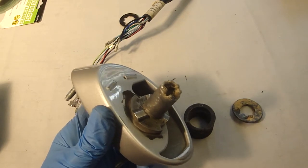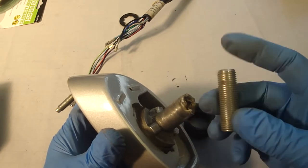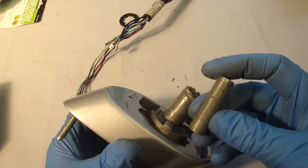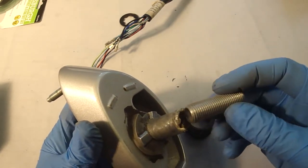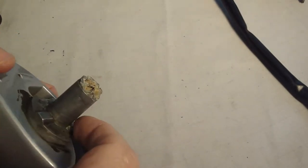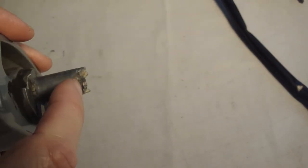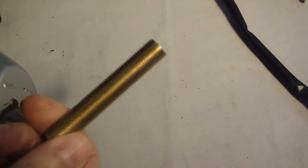I think I'm going to have to go to plan B, use one of these things. I wonder if these come in a slightly larger diameter and I could cut this off and replace it with a wider one of these so I'll have more room for the wire loom. I'll have to do some research on that. Okay, this metal is pot metal and I'm not confident welding it again. The working spring height comes up to about that line, so I'm going to grind this pedestal down to that line because I'm going to use a lamp nipple.